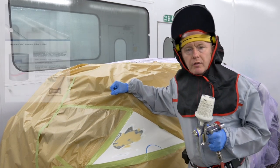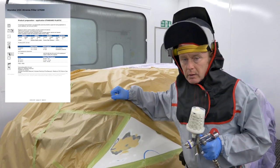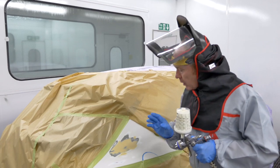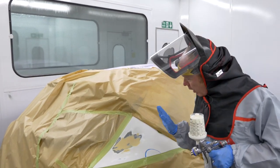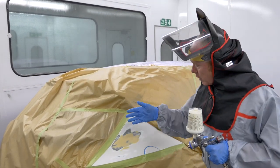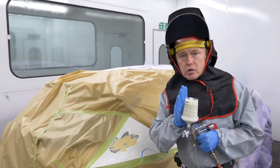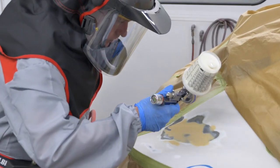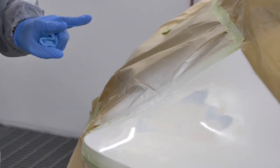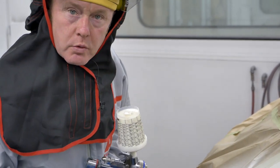Using this product is totally different to any filler or surfacer you might have used in the past. Normally a high build product is applied in single coats with an intermediate flash in between. With this however I can apply four coats without any flash whatsoever. But looking at this job with a polyester repair I would normally spray one coat just to isolate the polyester itself, seal off any pores and then depending on the film build I need I'll spray two to three further coats wet on wet. I'm using a 1.6 gun and I'm going to drop the pressure to one bar. That's the first coat applied — a light to medium coat just to seal the surface.